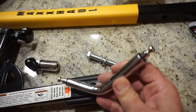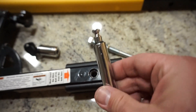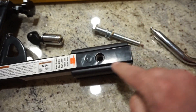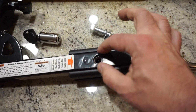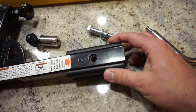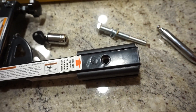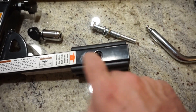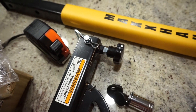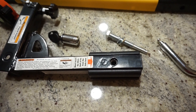I need to drill this out because my secure locking hitch pin won't fit through, and I've got either a class three or class four hitch on my Honda Passport that can tow up to 5,000 pounds. So I already have to drill it out to use the secure locking pin. I also noticed that even though I've got a two-inch receiver, this thing has a lot of play when it's in the hitch mount itself. I might wrap some duct tape or foam tape around it to keep it from rattling. So I'm going to drill this out and then take care of those two sheet metal screws.